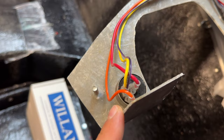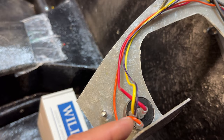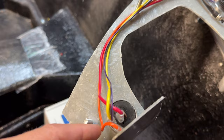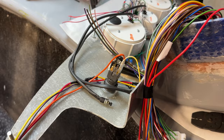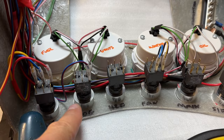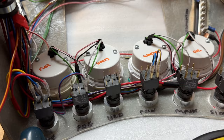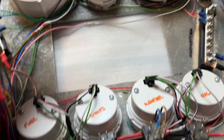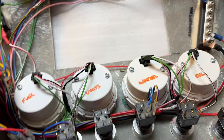Down to the last few wires — these green wires go to the hazard, then we follow through per the instructions. For the ignition: the red goes into the middle providing power, turn the ignition key to the next position and it livens up both sides — sending power this way and also to the orange cable at the starter button, so pressing it sends the signal through to start the starter motor. Important update: the blue-red I had for fog is actually for the main lights, so I need to move it. The fog is now blue-orange.